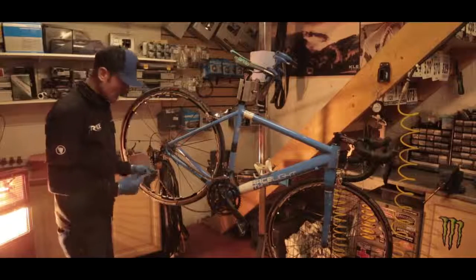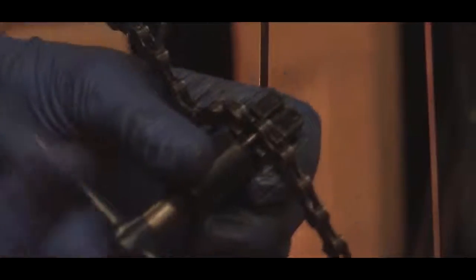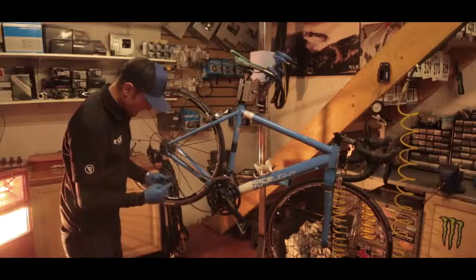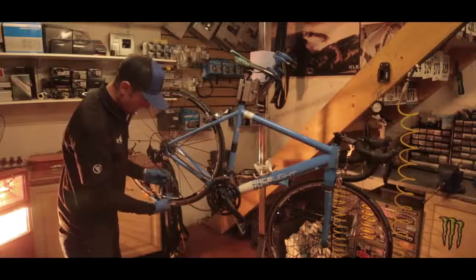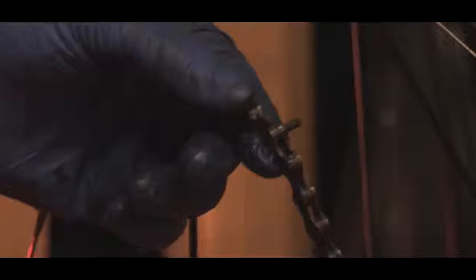Take your chain tool again and place it in the guide slot. Gently ease it through — you'll feel it's tight to start with, it'll go slack in the middle, and then it'll go tight again at the end, just as it seats into place. That's the pin in place. Now you can see the guide piece is still sticking through here — you need to break that off. A decent set of pliers, good grip, a gentle tug, and it comes away.